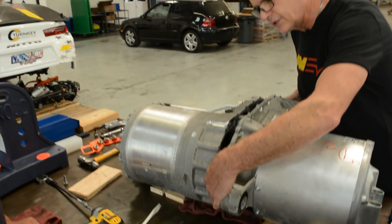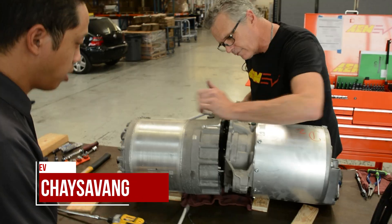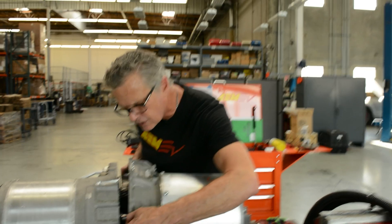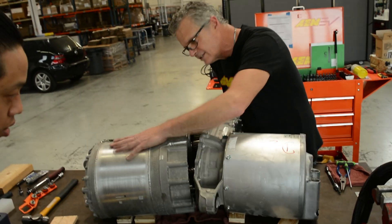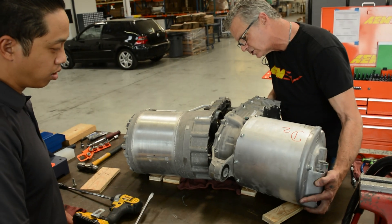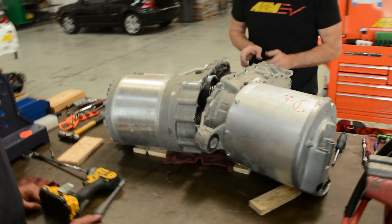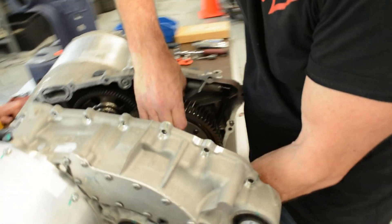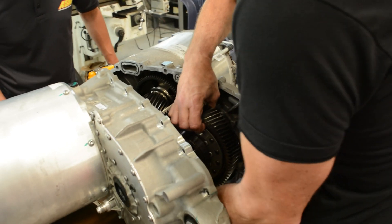We're really close to maximum separation right there. You can see your three high-tension bars coming in from the inverter to the motor. You can see there's a gasket as well, so you have to be careful — there's a lot going on in here and you don't have a whole lot of room to work. This is super heavy — that's the motor. This is way lighter, so it allows me to swing this over to the side a little bit and leave it right about here, which should give me enough room to walk the whole differential assembly out. You want to be really careful — you're working with a lot of machined surfaces and quite a bit of weight.